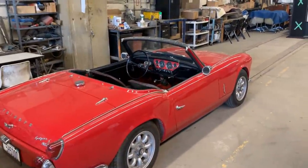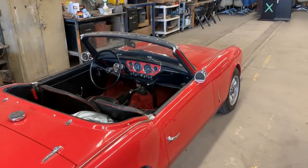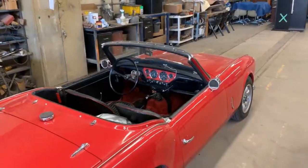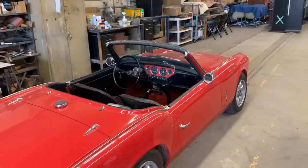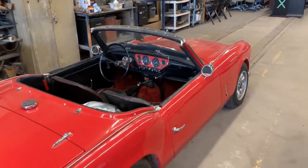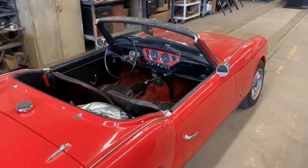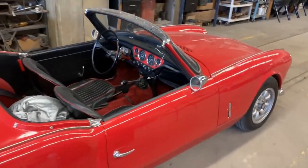The clutch is not slipping, it's exactly the opposite, it's not disengaging. Either the slave cylinder moved a little bit and now the rod is too short and it's not pushing all the way. But in this case, the pedal would be a little bit spongy and it's not, so I'm not sure that this is the problem. The other problem that I'm thinking of is the clutch plate. But I think we changed that clutch plate, or maybe the throwout bearing or something, I don't know. So we're gonna have to start taking it apart and we will see what we're gonna find.